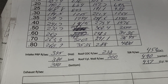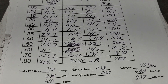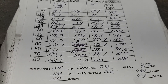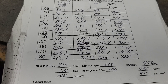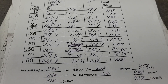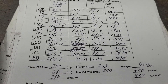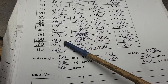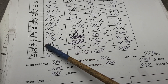We had a good comment on Speed Talk - the owner of these heads did a thread on 194 versus 202, and someone much smarter than me said you've already got enough flow for 355 at 8000 rpm. We do - but not through that intake manifold. So you guys can give me a little input on that: how do you make the whole system as efficient as you can? I think having a smooth intake port up to where we're going to flow - whether that's 500 or 600 lift - is key.